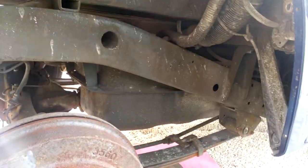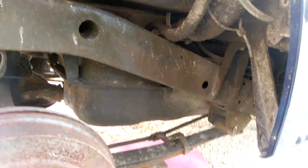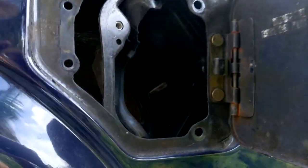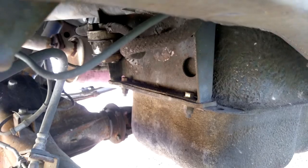As you can see, I already have the vehicle lifted up. The fuel tank is on the right-hand side of the vehicle. Some of the items you have to unhook before taking down the fuel tank are the intake hose, which I've already disconnected so it's free to move about. This is the back of the fuel tank and I have two nuts there, and in the front in a similar configuration are two more.